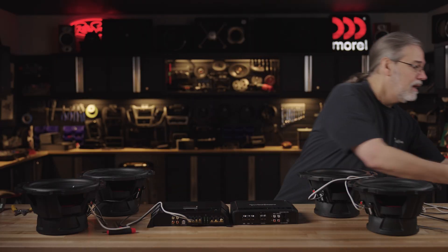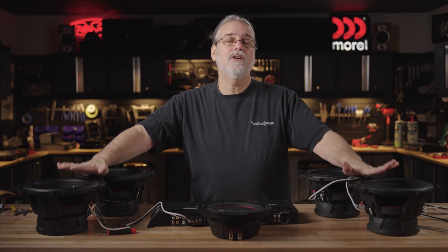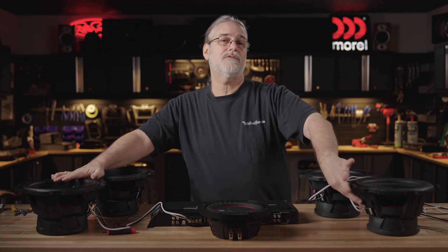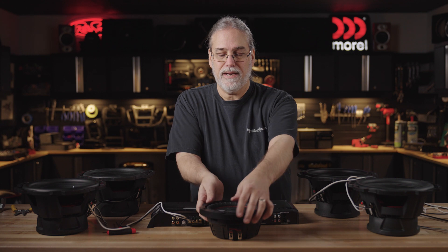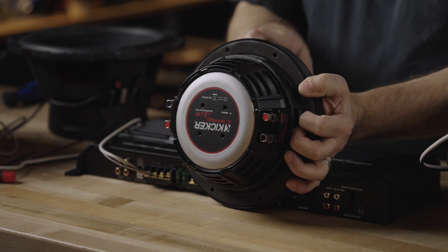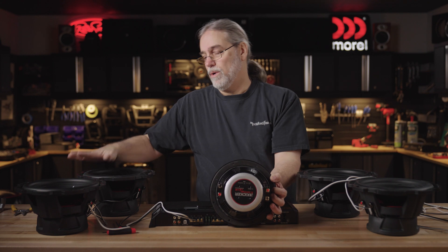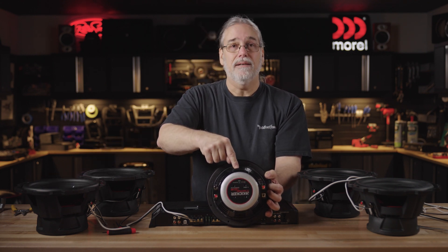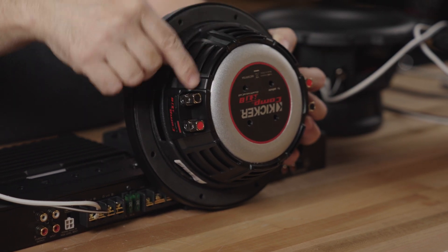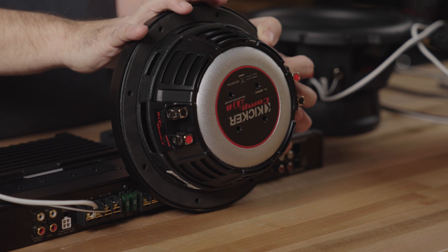Most of the time you'll probably be paralleling either a dual voice coil sub or a couple of individual subs. Speaking of dual voice coil, we have one of those to show you as well. Unlike these four single voice coil speakers - where you'll only see one set of speaker wiring terminals - on a dual voice coil subwoofer we end up with two sets of terminals. Basically this one sub can behave in exactly the same ways as either set of two, because this guy's got two voice coils already built in. So you can do the same series wiring or parallel wiring from this to your amplifier depending on your situation, to extract the best power and get the cleanest sound out of your subwoofer.